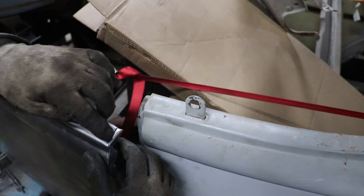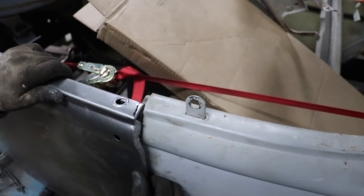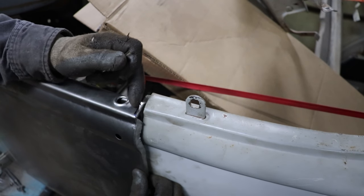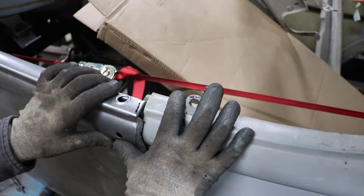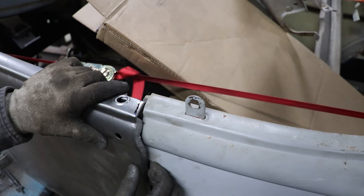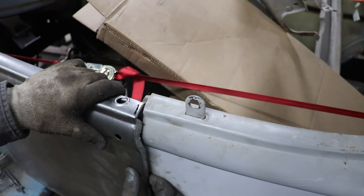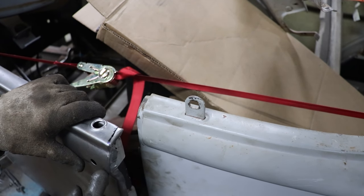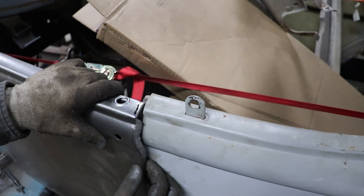So I just kind of whittled it away there in the center crudely with the cutoff grinder just to get it where I need it to be. I could sand it a little more as we go. Now I got the clearance. I'm probably going to take one single cut that goes from here back, taking it off on this inside edge, and that should give us the clearance we need. But now I can see it's flowing in. I'm going to have to probably start tapping some of these edges in, even though we're not ready to fold the edges over, just so I can get the clearance to sneak past there.